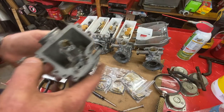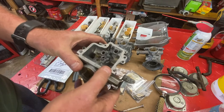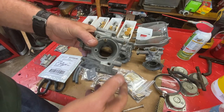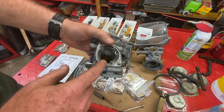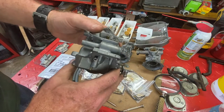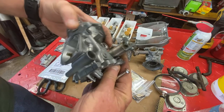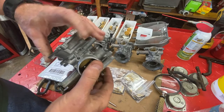Now, speaking of fuel tees — the plastic fuel tees on these old carburetors are extremely fragile and they're going to crack. If you can find a metal alternative for the carburetor rack you're working on, I'd highly recommend it. I found some on eBay — quite plentiful for the VFR across a wide range of years. I ordered an aluminum fuel tees kit that comes with O-rings. The last thing I want to cover is the actual carb bodies. When you ultrasonically clean one or go through it carefully with carb clean, you want to verify — 100% verify — that every passage and every channel is clear.